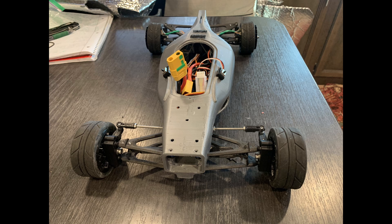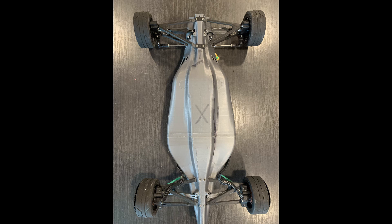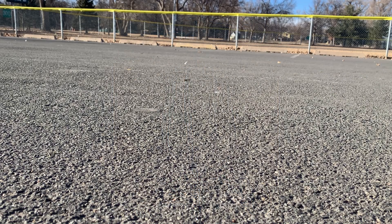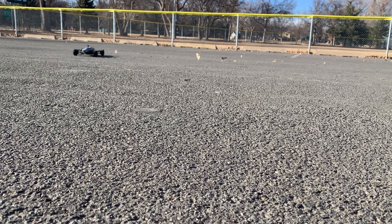Some caveats for the first run: I didn't even have the tires glued onto the rims yet because I wasn't sure they were going to work out. The motors are not using any kind of torque vectoring. Even though I have the hall sensors mounted, I'm not using the sensored ESCs yet — just a Y cable that splits the signal between the two ESCs, which effectively means I have no rear differential. I also have no roll springs or dampers installed. This car is entirely running on the heave springs, which are between the rockers and the flexor joints in the control arms.